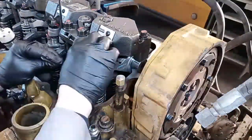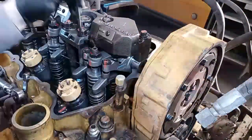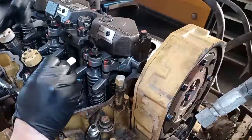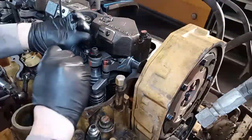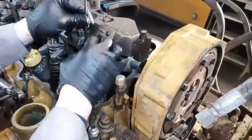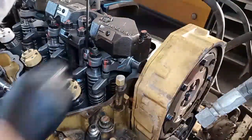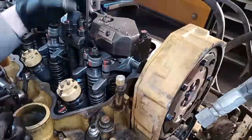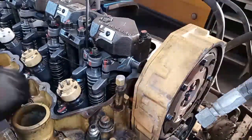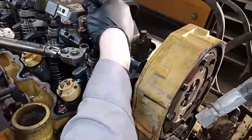Now we're moving on to the exhaust, which is 30-thousandths, done exactly the same way. I've put a red paint pen on the 30-thousandths gauge to differentiate it from the intake. Having backed everything off, it's easy to get the gauge under the rocker arm and between the valve bridge. Go finger tight, then past finger tight a full rotation to squeeze out any oil residue, then back to loose, then finger tight again. Run the lock nut down and grab your torque wrench.